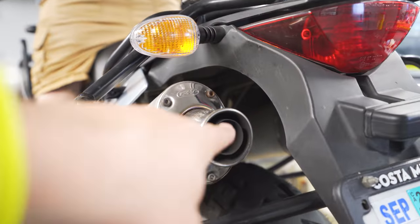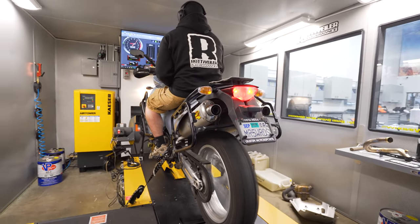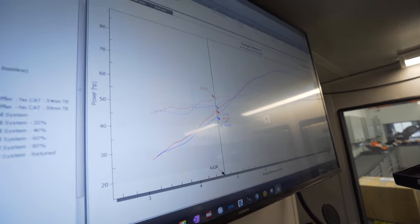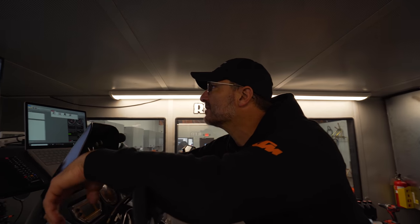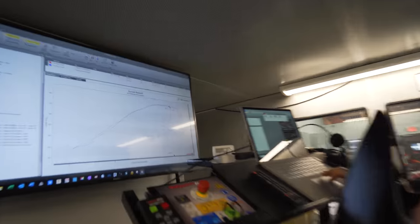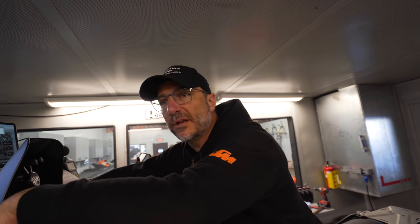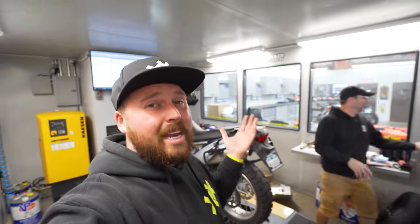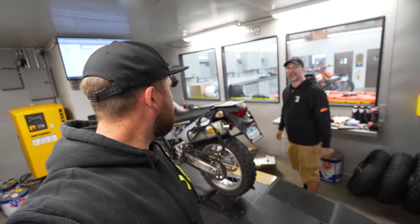Okay, so we've got them back in — let's see if these little guys make any difference to power. You're kind of swapping horsepower — you're losing a good three and a half horsepower on the bottom. It kind of gets negligible up near the top and then seems to be a little bit more up near red line. It's creating a little bit more back pressure. You lose three and a half on the bottom and you gain about one on the top. It's not a worthy exchange in my opinion for an off-road bike. So if you have these little decibel killers and you have a KTM 950 — probably any bike — take them out. Sounds better and makes more power. Rottweiler certified.